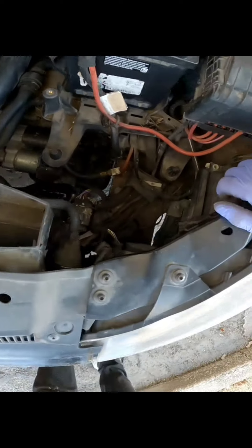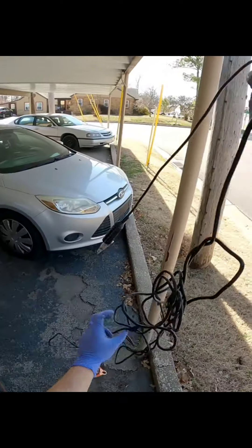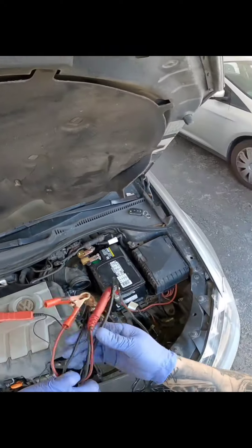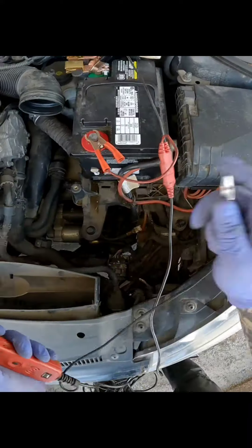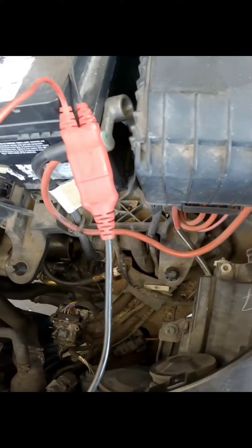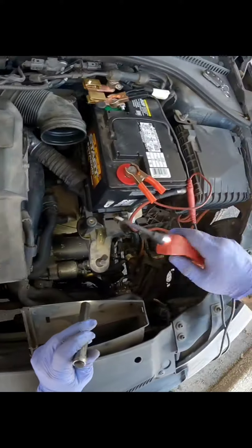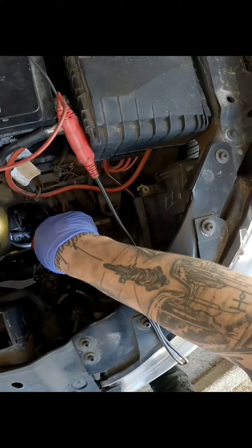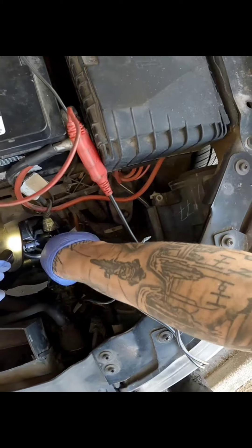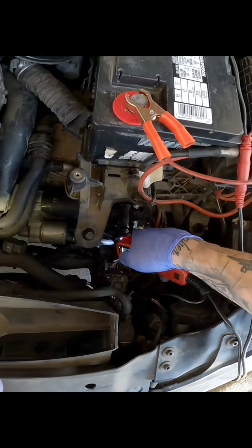It's wide open. Let's go ahead and curl this bad boy. I need to stop putting my electric components away so stupidly. Going to the ground on the starter - right on the ground there. With our positive side we're going to go to our signal wire right here, probe it... yeah, it's a bad starter.